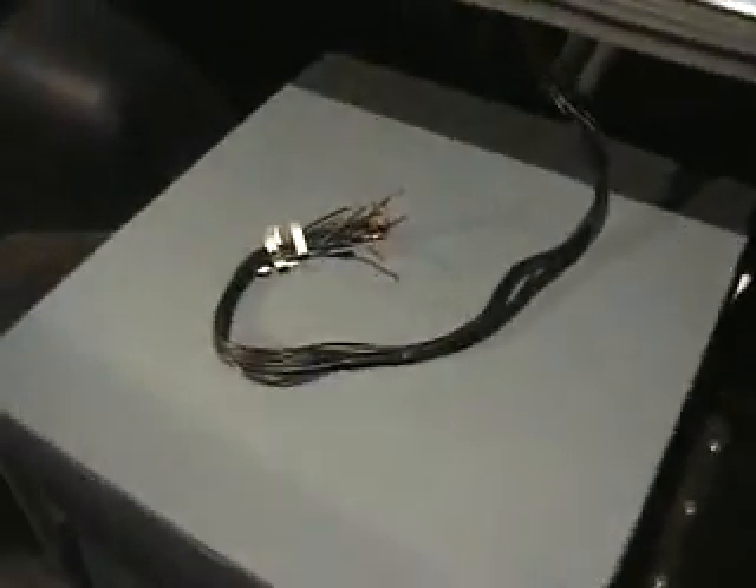I have also installed a relay at the back there, as well as the turbo timer. Those two work in harmony so that when I plug in the charging cord, you can hear the ventilation fans kick in. There is one fan visible here and another one around the back, which I will attach hoses to running out to these conveniently located vents. The turbo timer and relay mean that when the plug is in and the car is charging, I cannot turn on the ignition — nothing will happen.